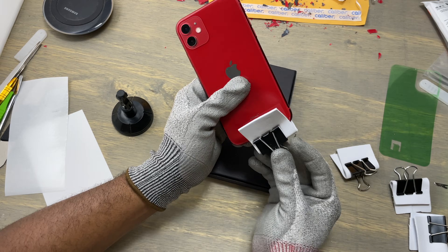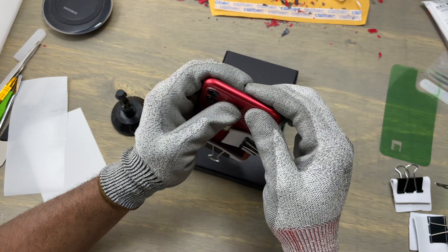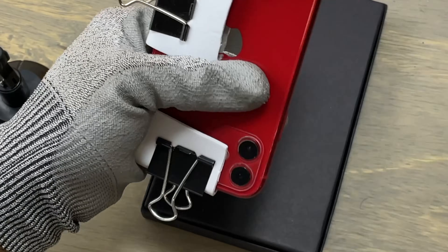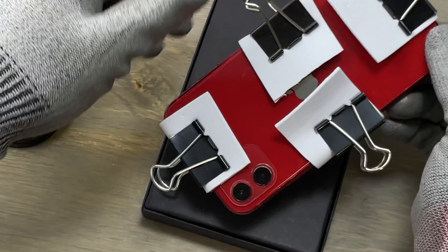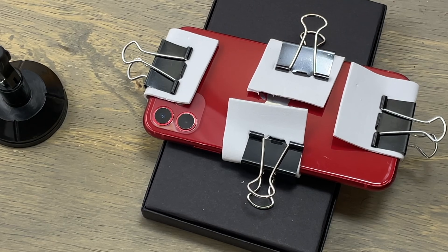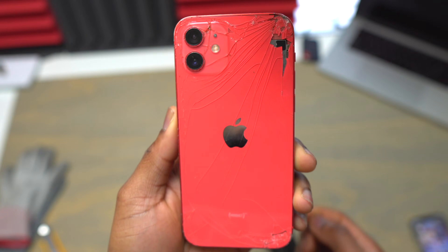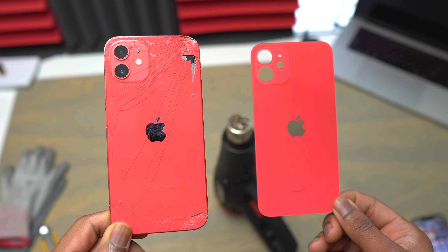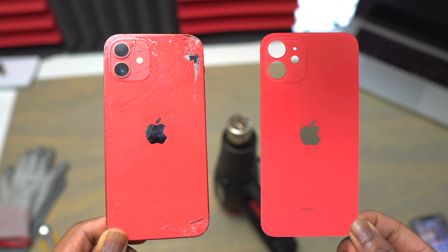After putting B7000 all around the components and avoiding all openings, take your glass and apply it to the back of the device. If you've cleaned everything correctly, apply a little bit of pressure and it will start to stick. Then apply some clamps to hold constant pressure on the back glass against the frame. While removing the glass around the camera, the camera rings might get slightly bent — you can apply a little force to flatten them and then place the camera rings back on before or after attaching the new glass.